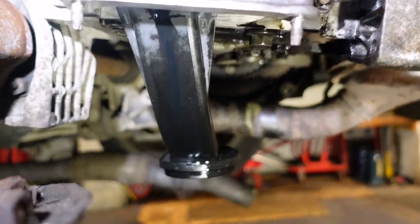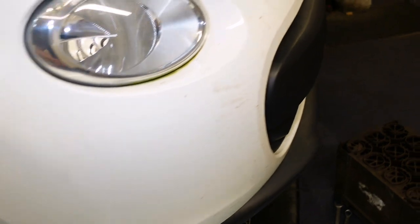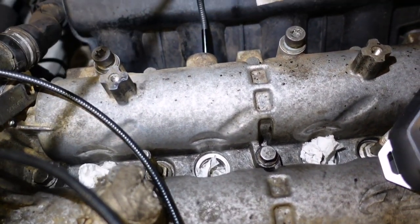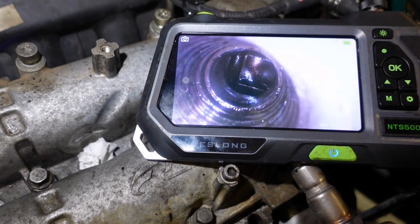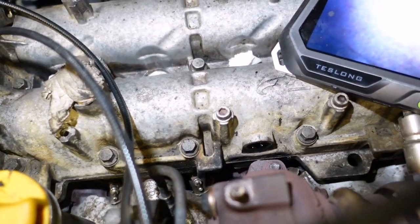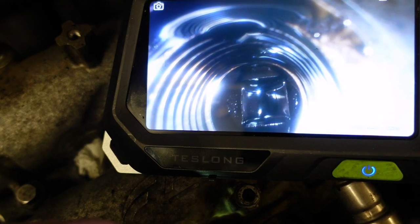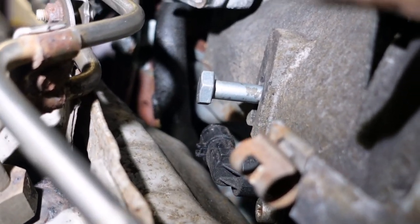I forgot to mention - it's a good time to check the pickup. This thing had leaking injectors but I didn't expect any carbon in the pickup because the design is such that carbon can't really get into the engine - it just comes out the top. I've already checked the timing with the locking tools and she's dead on. We'll just put the borescope into the front one, the one I can't get the tool into. There we go - let's see what that looks like. Perfect. There we go - with the pin in the crank, all lines up. Rotated two times and that's it.